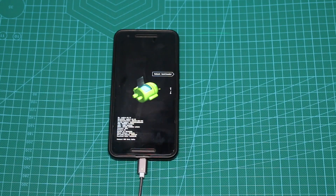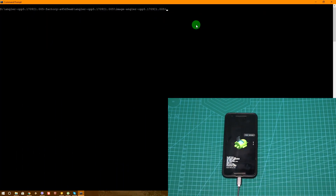Now what we're going to do is move to our computer and basically run the command: fastboot flash boot, navigating to our oreo-4-cores.img. Basically this file will run only the 4-core kernel, and we'll hit enter.